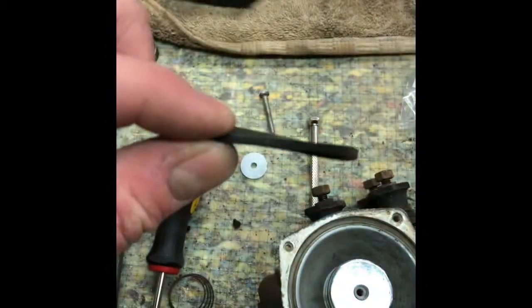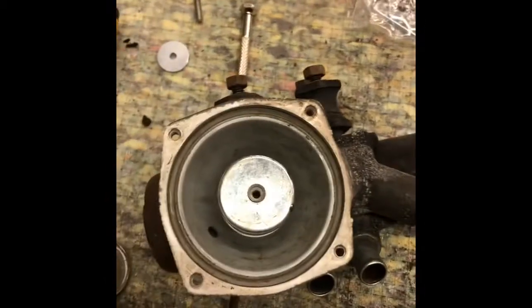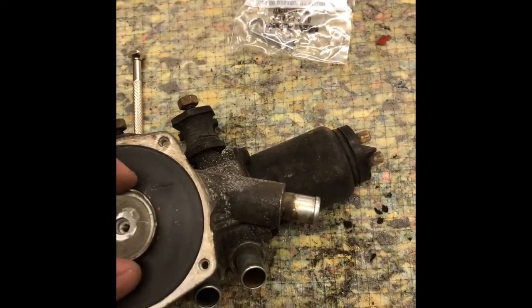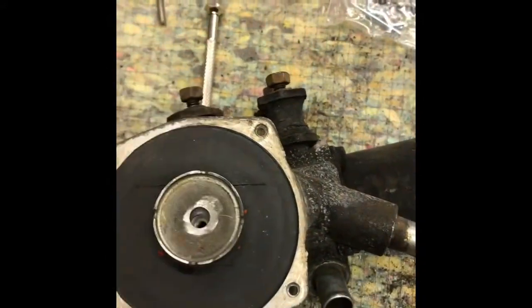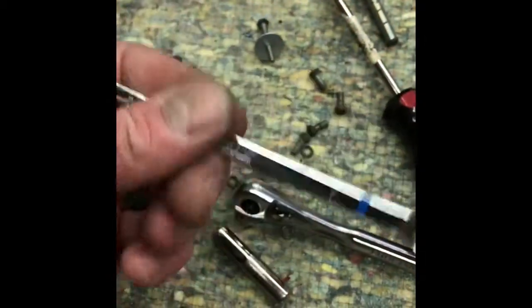You have the ring around the outside edge. I can't find an O-ring tonight to fit this gap around it, which I'm sure it needs. My plan is to use the wheelbarrow rubber on here, then set this on top of it, and then you need your washer. That size washer works perfect — 1/8 by 3/4. You can see the 1/8 is almost exactly. It's a 7mm nut holding it on, and I had to go buy a 7mm wrench.